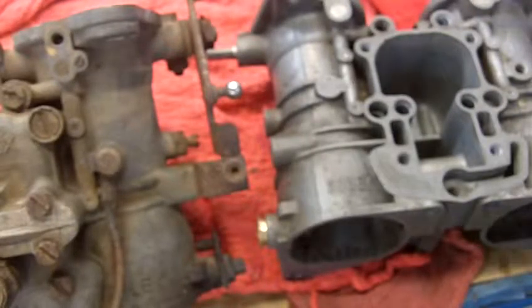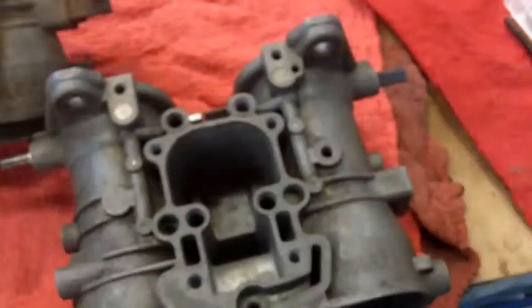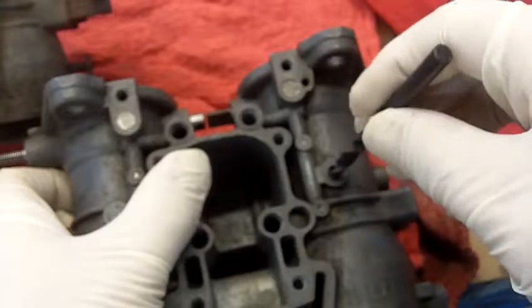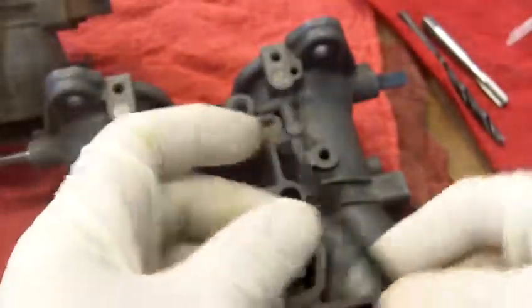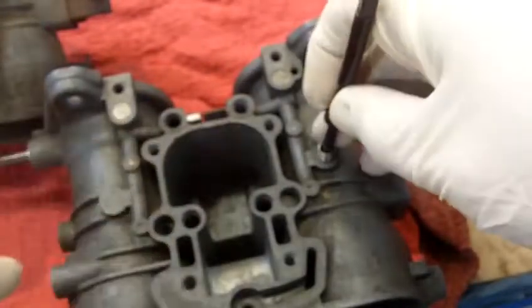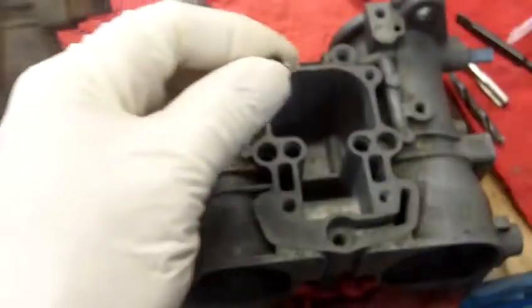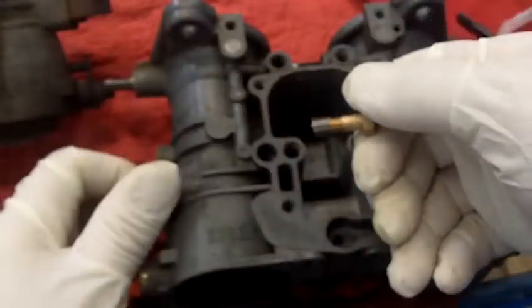The problem is one has to repair these threads, and in order to do that you have to disassemble the carburetors. The sequence is: you have a special drill that comes with the repair kit, then a special tap which screws in to make threads, and those threads are designed to hold this stainless steel insert. You thread this in there, and when you get finished, the inside has the exact thread pitch for this hollow bolt — and just like that, you've got brand new threads in there.